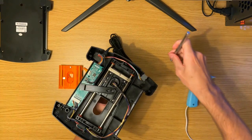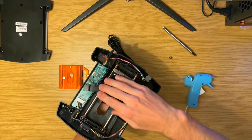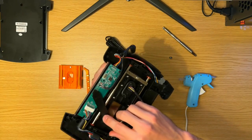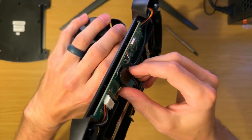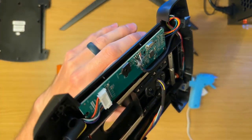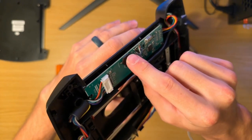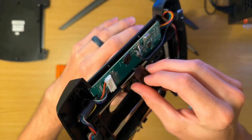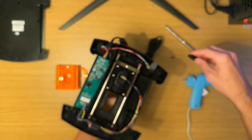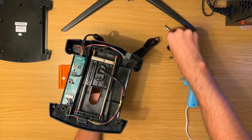The swing arm is the most vulnerable part of this throttle system, especially when taking it apart. What I would recommend now is grabbing here and then just pinching it out of its little actuator. Because on this circuit board there are little clips around each side, and bending this away like that will eventually wear them down and break them — this thing will not stay put. It'll still work, but the arm will not be rotating on the correct axis. So gently remove that — slow is smooth, smooth is fast — and then we'll have that ready to go back in.